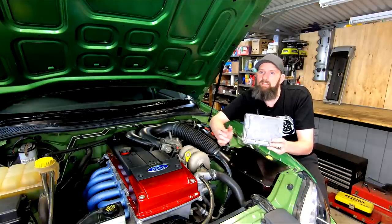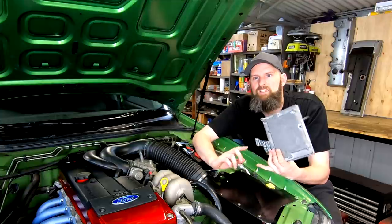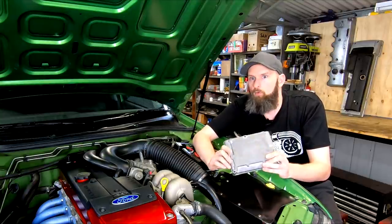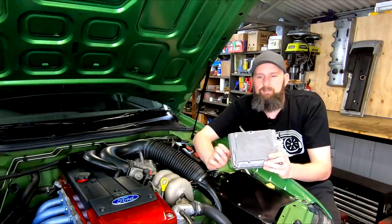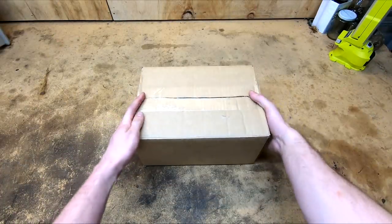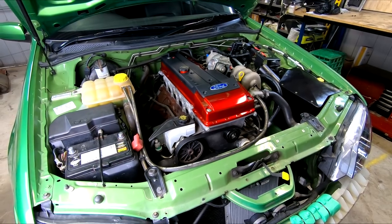So we can fairly safely drive it over there. I won't be driving it hard on this tune, and doing it this way may cost a little extra for that base tune. But this will allow us to test for fuel issues or leaks, and set the car up with things like the new map sensor and fuel pressure regulator. That on a stock tune won't run well or at all with these. The car won't run on the ECU anyway as it'll be reprogrammed for some parts we're yet to change — oh, and because of this removal, or at very least I'd have some pretty ticked-off neighbours.